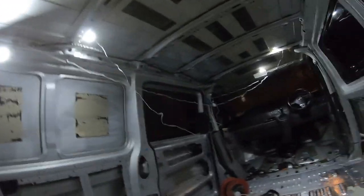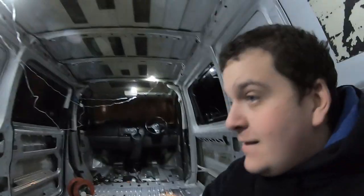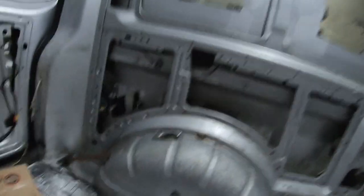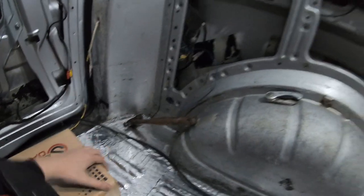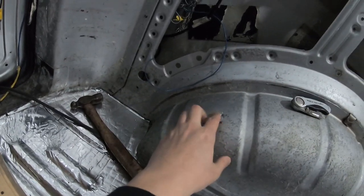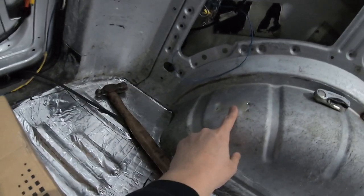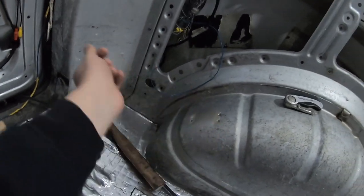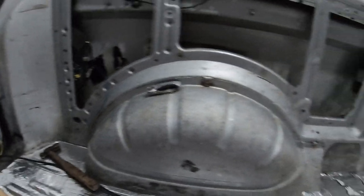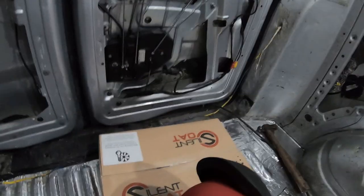Welcome back to a cold van — it's dark and I've jerry-rigged a couple of spotlights to light up the inside, and four spotlights do light it up quite well. I've just removed the bracket — I used a 5mm drill bit followed by a 9mm drill bit to drill out the spot welds, and then the plate just came off with a bit of persuasion. Now I'm going to crack on with this arch and I've had to start on my next box.